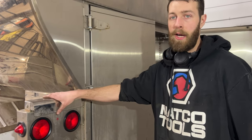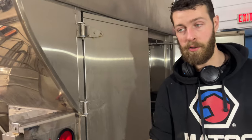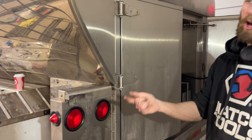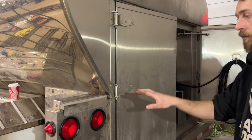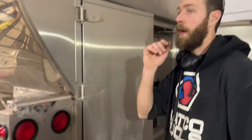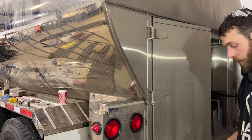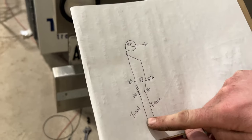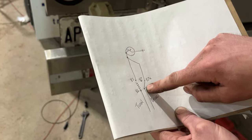There is a converter box you can buy from Curt that takes three inputs — a stop signal and your two turn signals — and it outputs a ground and gives you stop-turn. That allows you to do exactly that: when you're slowing down with your foot on the brake, the turn signals still work and the brake light still works on the other side. They do that using relays inside the box.